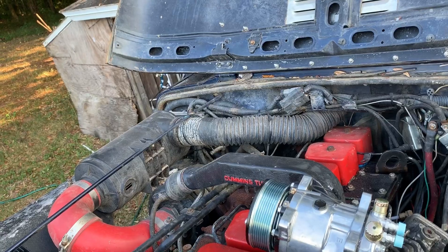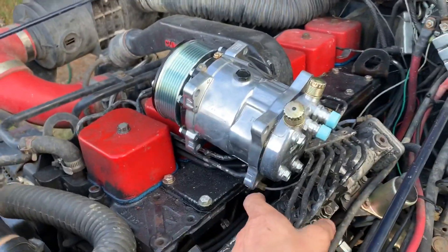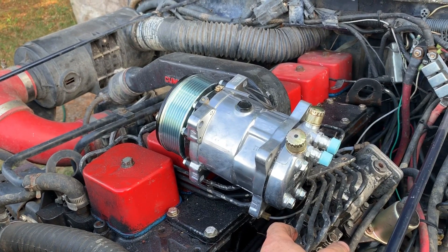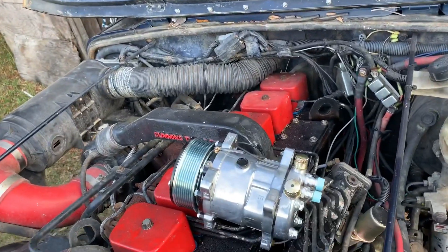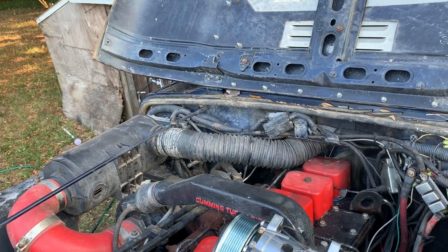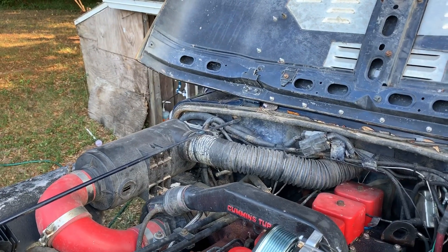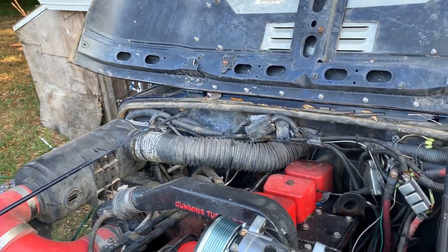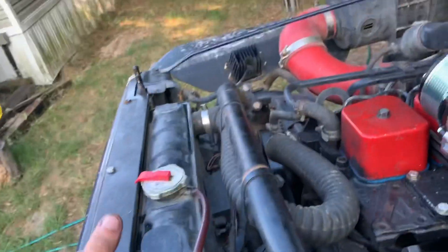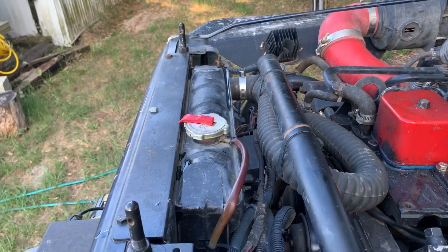It's pretty much going to boil down to which one's cheaper, honestly. I've got maybe $120 to $160 in the pump and around $60 in the AC condenser, and another $60 in hose with all the fittings — I'm trying to do this as cheap as possible but still be efficient. I'm going to be using the stock Jeep evaporator; I've got it plugged off from the swap and I'll get it cleaned out. I'll probably have to braze some fittings on the end since they have weird quick disconnects. Same situation with the condenser — the stock Jeep used weird bolt-on fittings, so I went with an aftermarket universal one for simplicity.